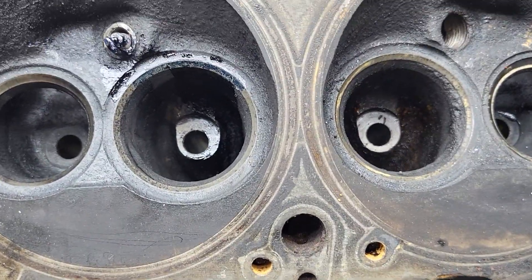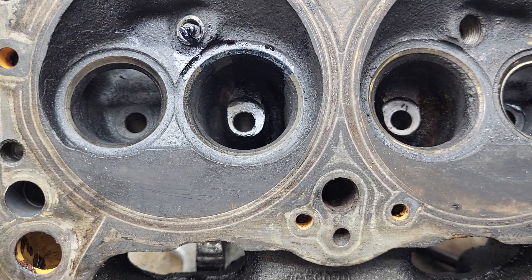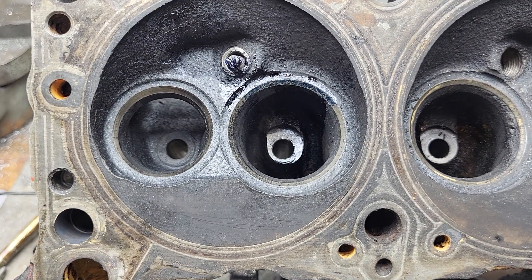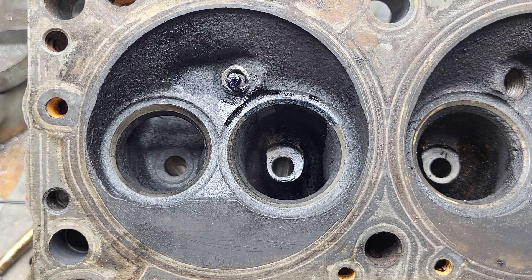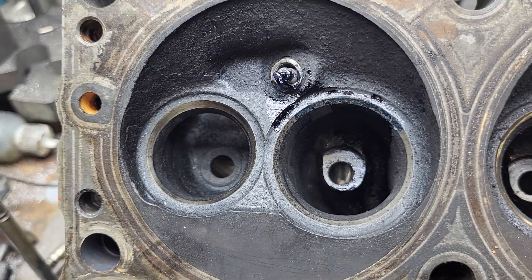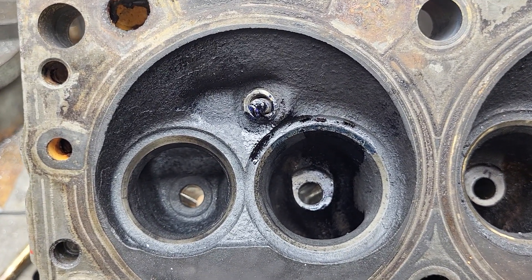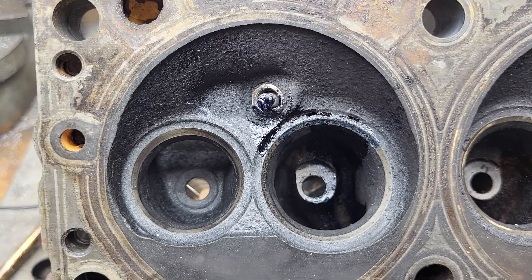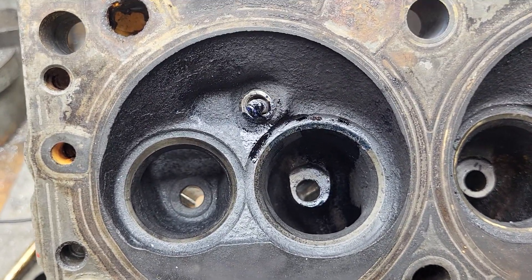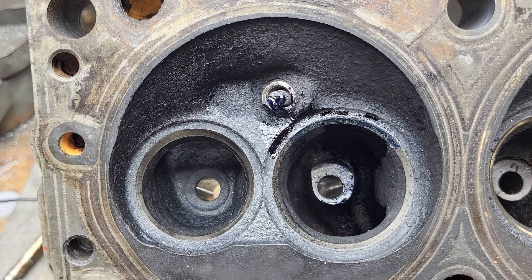This one looks like a chocolate milkshake - that's what it looks like when you get water in the oil, so there's a really good chance these are cracked. I'm not going to sweat it too much. I'd be more than happy to cut these up after we do some work on them. Let me know what you want me to do on these 318s - if you want a max effort, cut it up, I'm pretty sure you could convince me. I'm kind of stalled on the Jag heads - putting off finishing the swirl ports because they're a nightmare. But I do want to get this all set up so when those manifolds come in from Andy I can go right into development. Leave a comment, hope you enjoyed this, thanks for hanging out, have a good night.